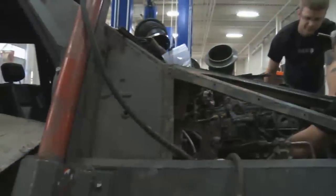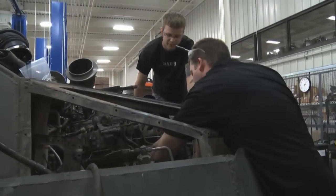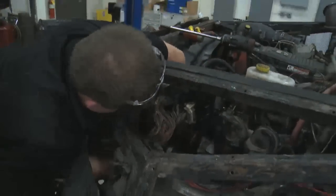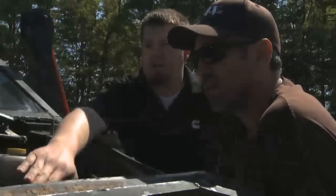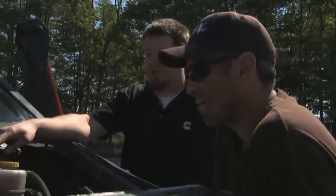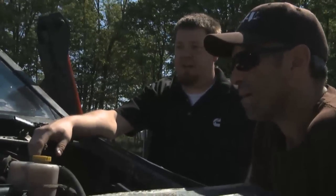As you can see here, we went through and cleaned up a bunch of your wiring — found several wires that just kind of went to nothing. We removed all the aftermarket stuff that was on here and put the engine back to all stock. We added the fan shroud back on to help with cooling, put a new intake on because the other one had holes for the aftermarket in it, and got a factory airbox reinstalled to help the engine breathe better.